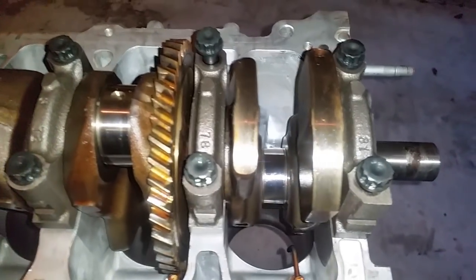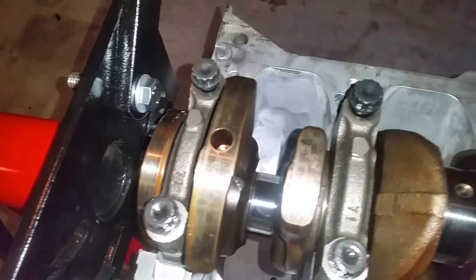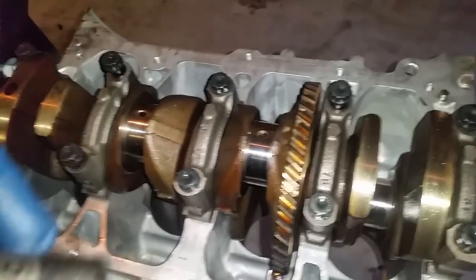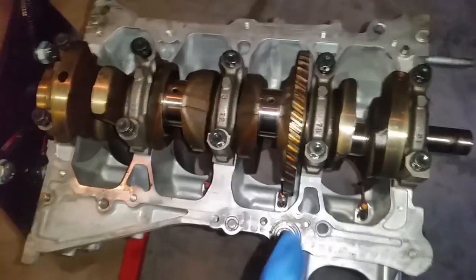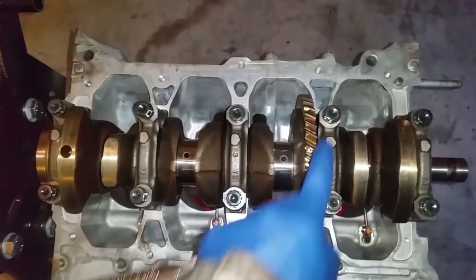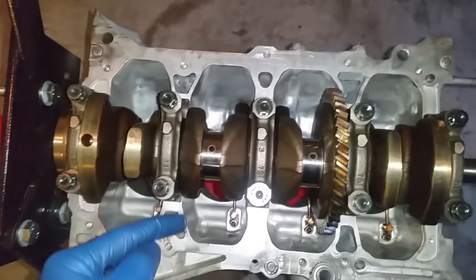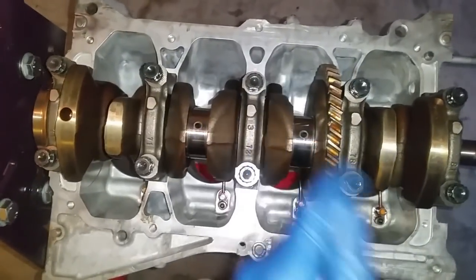All right, all the main bolts are hand threaded, so they are engaged. And now I'm going to use my 14 millimeter and ratchet and start driving them down. Still not tightening, I'm just driving it down until I feel just a little bit of resistance. And the sequence goes from out towards in. So you do 1, 2, 3, 4, 5, 6, 7, 8, 9, 10, or 1, 2, 3, 4, whatever you'd want to do, but from out, out, in, completely center.